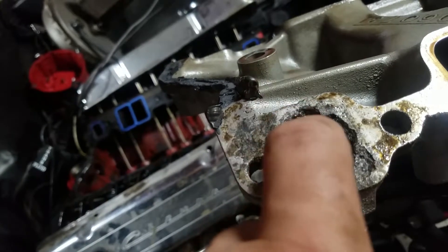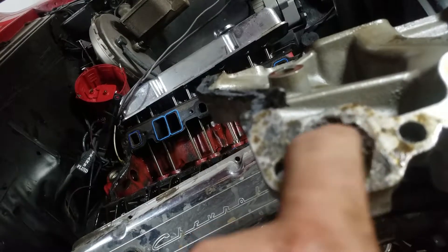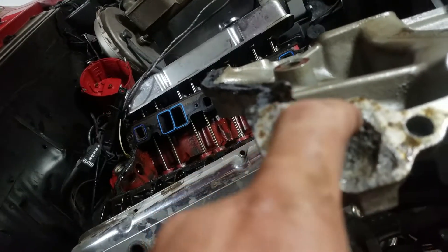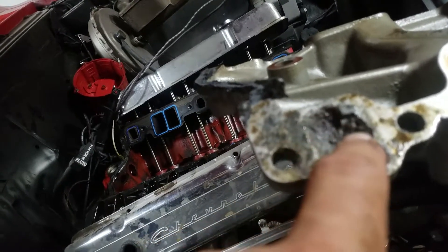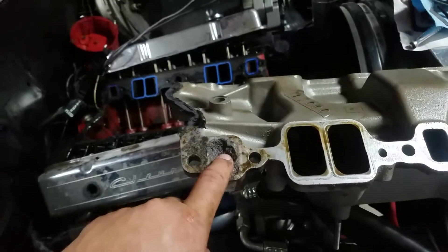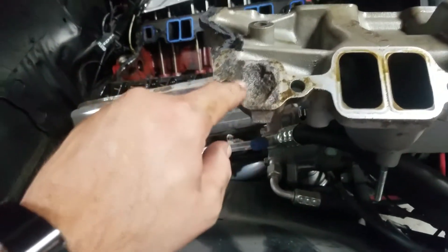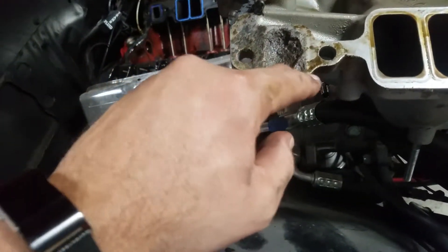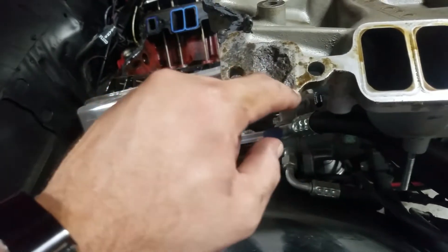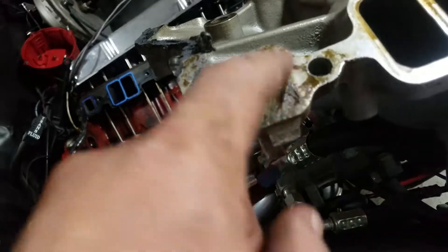Right here is gonna become a problem in a few years if we let this corrosion go. At some point, if you get that motor hot enough, it's gonna create a little pinhole right there and you're gonna have serious trouble. I might end up having to get this repaired depending on how much I get picked out. My guess is this might have been a swap meet buy — like, oh cool, we'll get this intake manifold, then when they installed it they realized it wasn't everything it was chalked up to be. We're looking at maybe a sixteenth of an inch of sealing surface — that's just a roll of the dice.